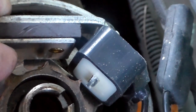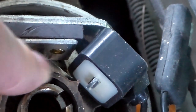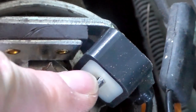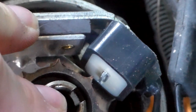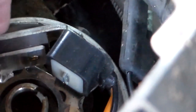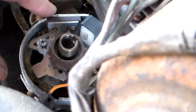The next thing I noticed was look how far away the pickup coil is from these tips right here. Normally when the tip is next to the pickup coil it's supposed to be straight across — like if you drew a line from here to here it would go straight through that tip and straight through that. This thing is way off to the side — it'll never work like that, it's not even close. It appears to have the wrong pickup coil in it, and it's not even attached to its distributor. What on earth? I know some people are not mechanically inclined but that's ridiculous.